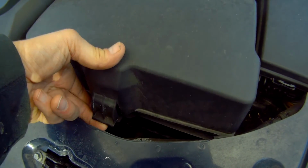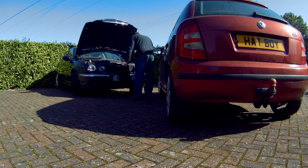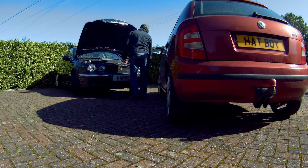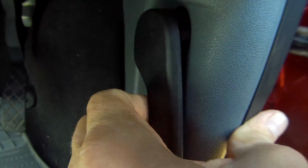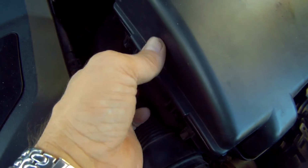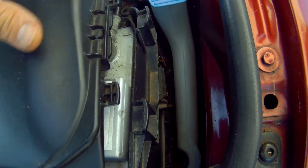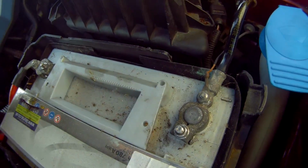In this case the cover comes completely off. If it doesn't, just make sure it can't interfere with the cables and the clips. Sparks can occur and the fumes given off the batteries can ignite. Batteries can explode, so care is needed. If possible, do this outside or at least make good ventilation. It's also important not to get tangled up in the cables, so don't rush this job.